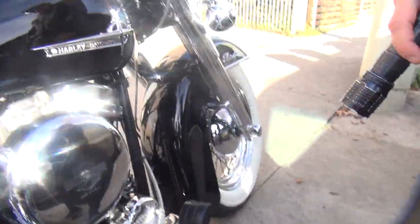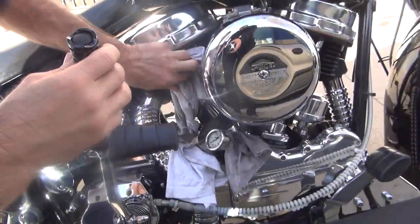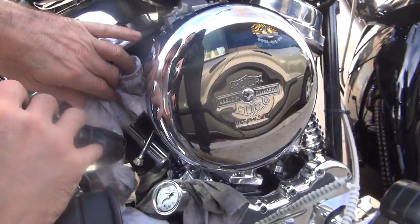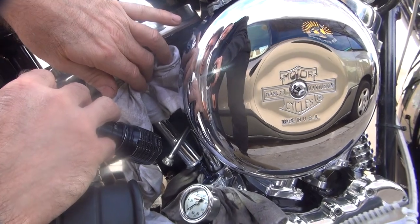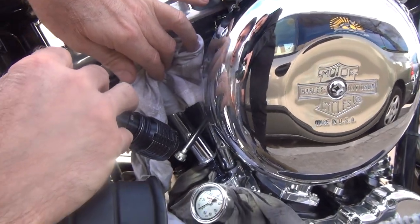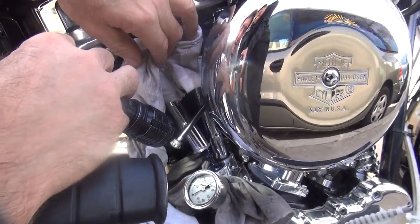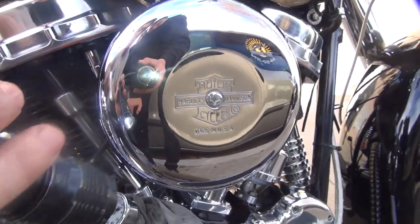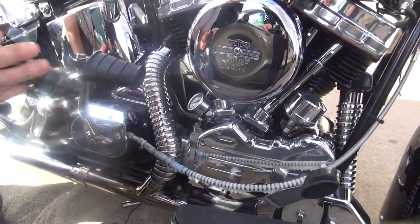What do you mean you can't see without the sun? Here, Morrell, you're in charge. Wait, what are you recording? What are you doing? We're trying to determine what kind of cam he's got in this bike. Oh, you're trying to determine what cam? Yeah, okay. He's definitely got a Jim's hydraulic lifter kit in here with their aluminum lifter blocks and lifters. So that means you've got to use a shovel head, pan head style cam. Being a generator bike, it'll be a generator cam.